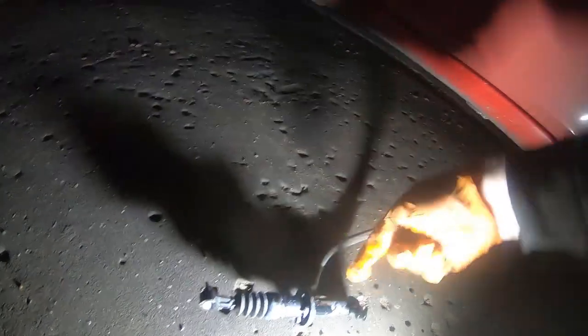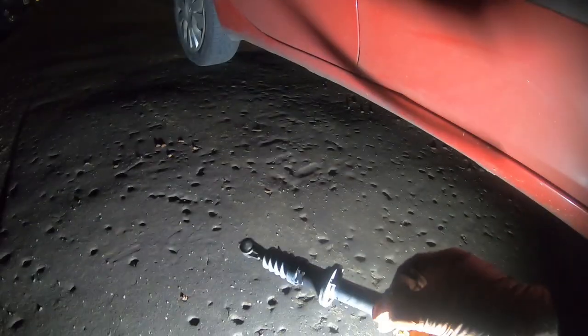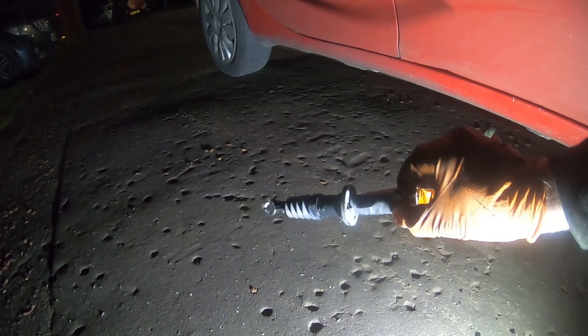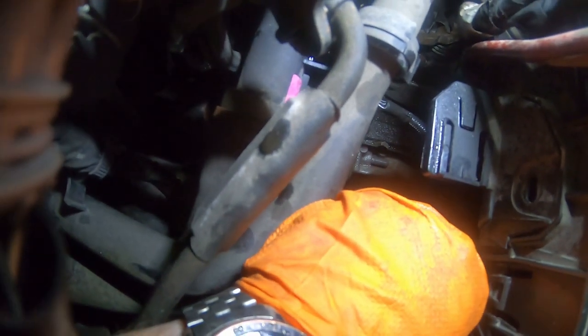So I just need to snake this hose in, and that says it's a bayonet fitting, and just put it in and turn it anti-clockwise a little bit to secure it in place. So it took quite a bit of doing, it's quite a number of hours later, and the trick to bleeding these is different, you don't have a bleeding nipple which you undo. You've got your brake hose here that goes into your slave cylinder, and it's secured by these two clips.